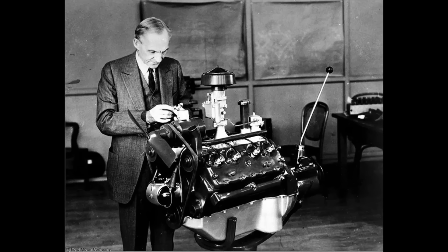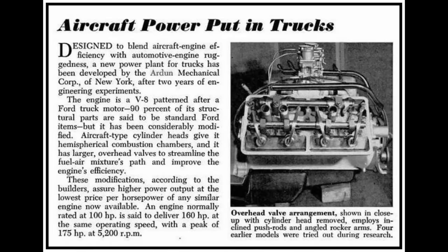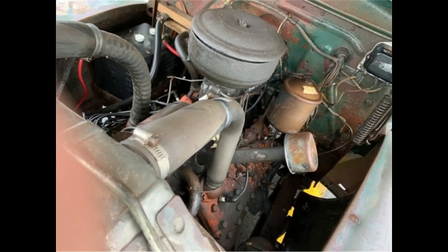Getting back to the Ford flathead V8 on the positive side — it's an iconic Ford engine. If somebody says they have a 21, 24, or 27 stud engine, you know it's a flathead Ford V8. When running exhausts or open headers, it sounds like nothing else. Parts and active club support are plentiful. Some can still overheat, and you can get some serious power out of them, but it will cost you some serious cash to do so. In stock form, it can sound like a sewing machine with just a little growl. Some people say you haven't lived until you've changed a water pump on one of these — implying the job is hard, because the engine sits way down inside.